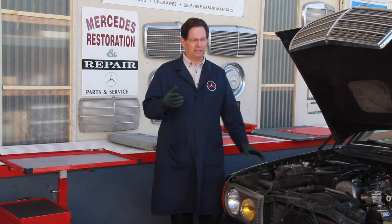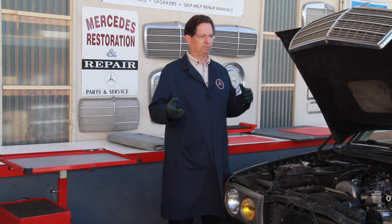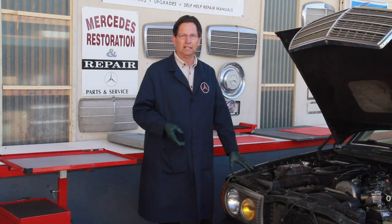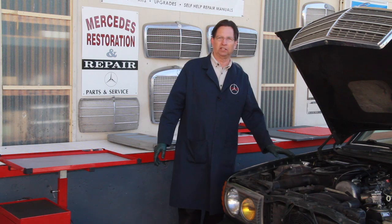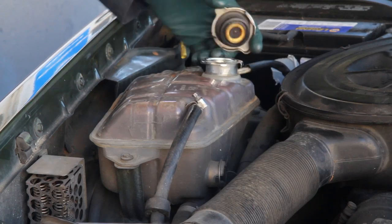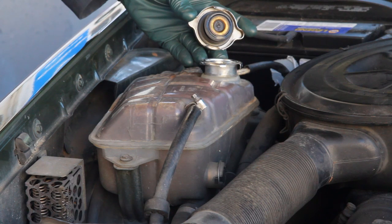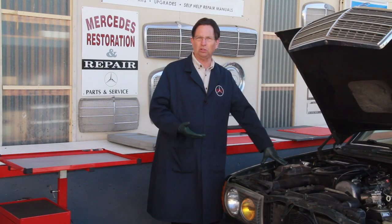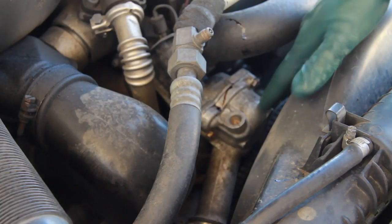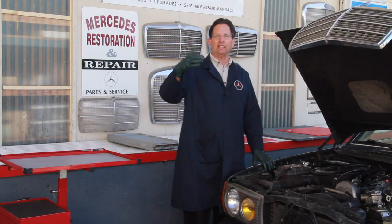When he picked up this car he knew there was a problem with it — it was losing coolant and there was an overheating problem. Right away you could spot something was going on with this coolant reservoir tank. Look at the coloring on that thing — it's a little dirty, a little rusty inside. He said the engine runs great but it smokes when you start it up, kind of a white smoke, and then it keeps overheating. I recommended that he pull the thermostat out, and that kind of solved the overheating.